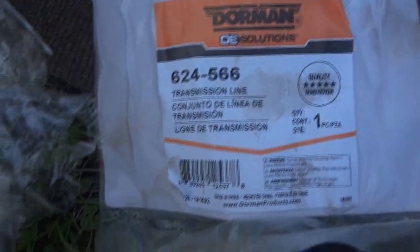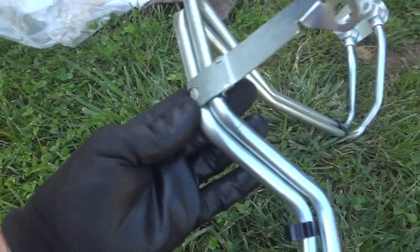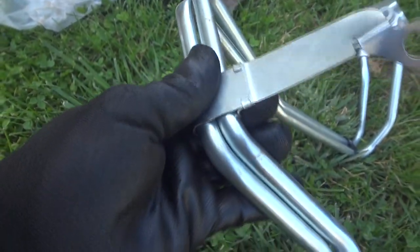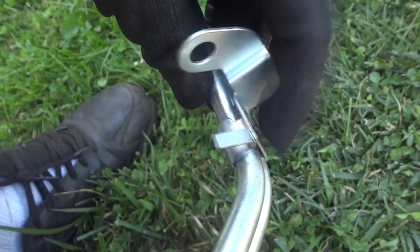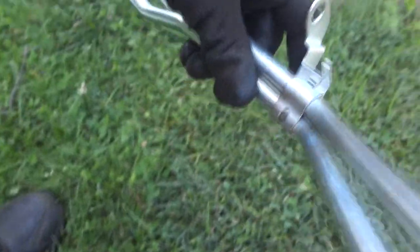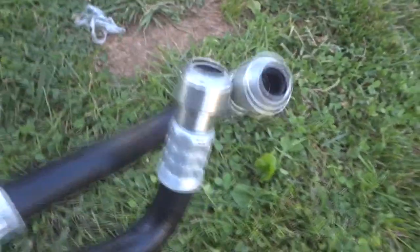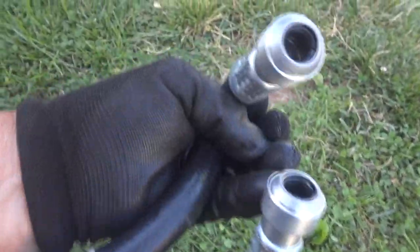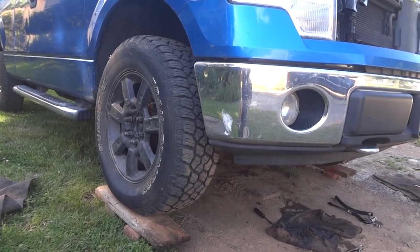This is a Dorman part — I'll put the part number in the description. I ordered it about six months ago. They actually gave me a bracket — you can see these little ears here. There's a plastic clip I'm going to take off so I don't lose it. Here is the other bracket that goes up on the front of the engine. What I'll do is take this off and slide the whole thing in — so it doesn't get caught up — then slide it back on. Before you put it up in there, get some tape and plug these holes because when you're sliding these through, you don't want any junk getting in there and messing up your transmission. I'll put tape over that and start sliding this through the engine bay.